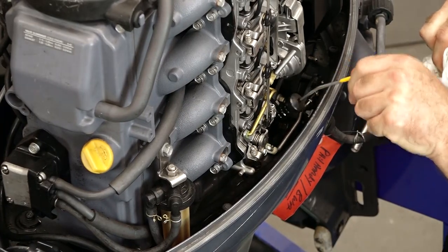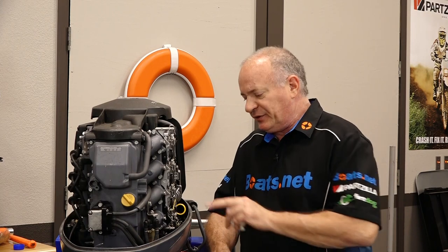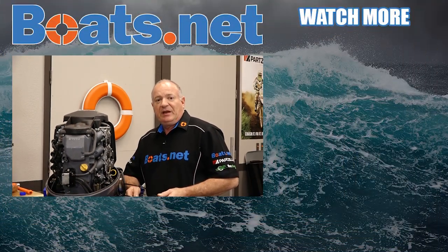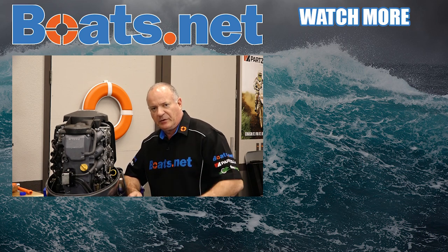All you need to do next is crank yours up, let it run for about 4 or 5 minutes, sit for about 30 seconds, then go back and check your level. I still have several more projects to do on this particular outboard — if you'd like to see that happen, hit that subscribe button so you'll be notified when we set those next videos live. If you need any parts for your boat, come see us at boats.net. Leave any questions or comments in the section below and I'll do my best to answer them. Thank you for shopping with us at boats.net — we will see you in the next video. Y'all have a great day.